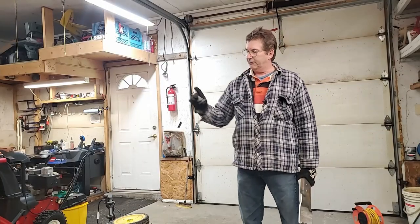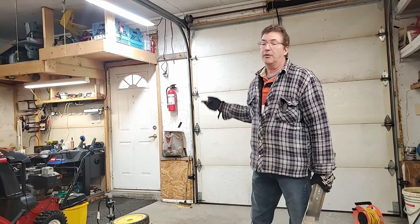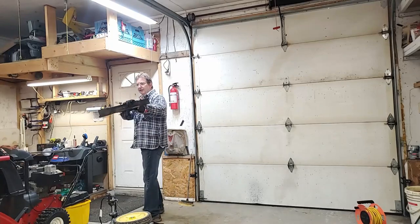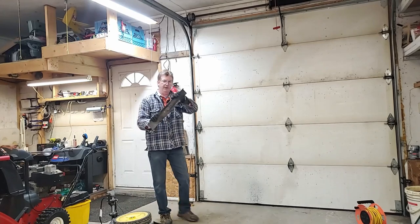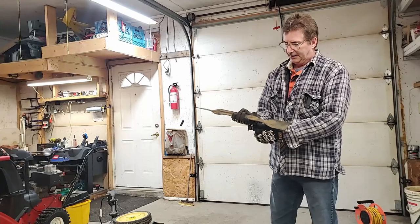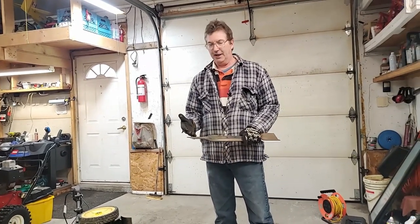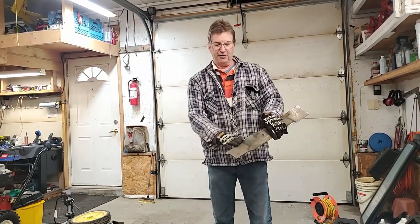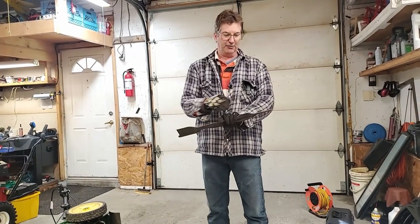Okay, I'll put a link in the description for one of these tools to balance your blade. You can do it two ways, and I did it both ways for you. You can either use this tool, or if you got a nice round hole, you can just put something in a vise and put it on and just chuck it this way, same thing. And the way you balance these blades is as you sharpen it, if you got one heavy side, as you're on the surface where you're sharpening, you just take more off this side until the weight's even on both sides as you sharpen both sides.